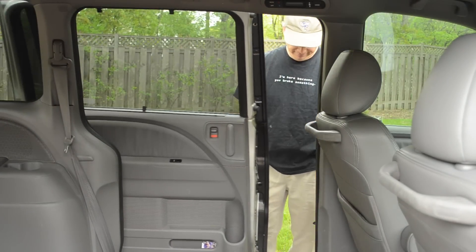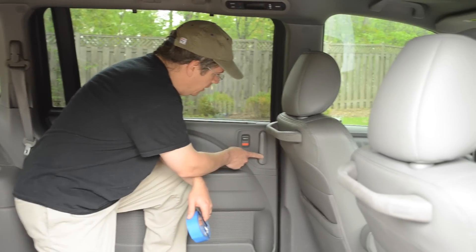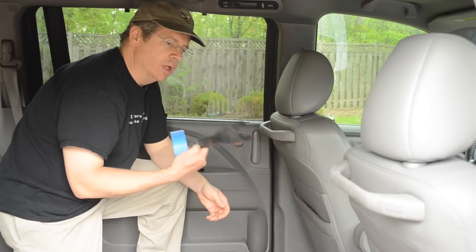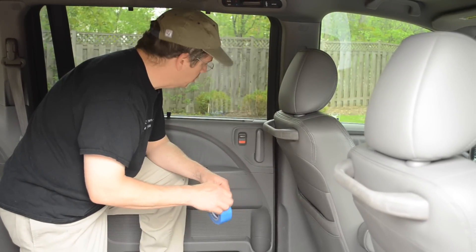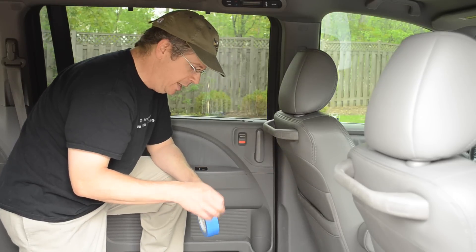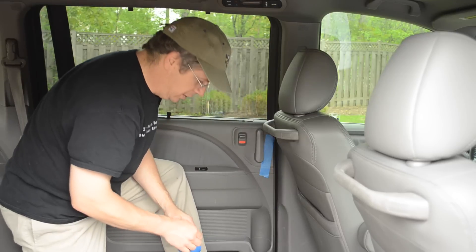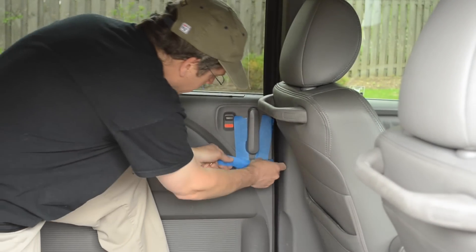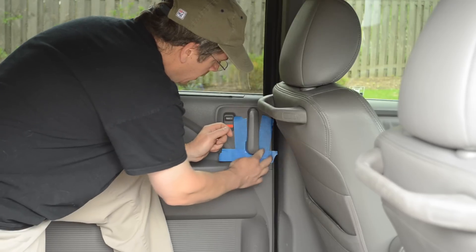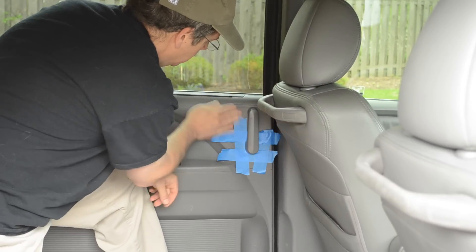Once you're at this stage, close the door. Then we're going to pull up this handle and you'll want to get your door puller tool or a screwdriver. Also get some blue tape or masking tape to protect the plastic here, because we're going to be scraping in this area. If it's a customer's car, be especially careful to protect all of this so you don't cause additional damage. Work the tape into the area and get behind the door handle as well so that whole area is masked.